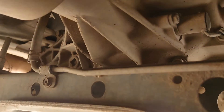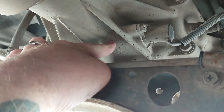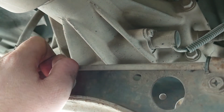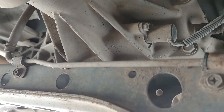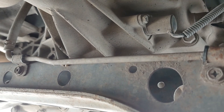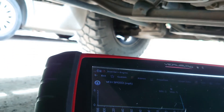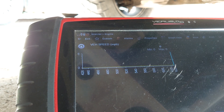So that only leaves the actual speed sensor here — that's the only component that could not be working. There's either the chance that the plastic drive might be damaged inside and it's not turning, or whatever turns the drive inside the gearbox is damaged. Sadly, here today I don't have the ability to take it out and drop all the gearbox oil because the guy needs to take it on. So we'll have to get that out and get that checked. It's pretty obvious from there — we're just doing the diag on it. If it needs a new speedo drive and it's all in place then it's all good; if the drive's stripped, then it'll still need a new drive. That's pretty well it for a quick check through. Hopefully you found this fairly informative — don't forget to come back for the next one. Cheers.